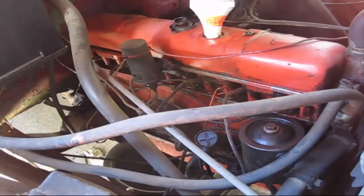So I totally believe in this stuff. This stuff works. But another thing about these old engines, I know some of y'all probably don't know this, some of y'all probably do, is don't put a multi-weight oil in these engines. They weren't designed with that back years ago, and they like straight weight. Put either 30 weight, 40 weight, something straight. Don't put no 10W30 or 5W30 or anything like that. Don't put no synthetic in them either. They're used to real oil, so put real oil back in them. Unless you completely rebuild the motor and it's designed to run in those parameters, I don't do it. Just saying.